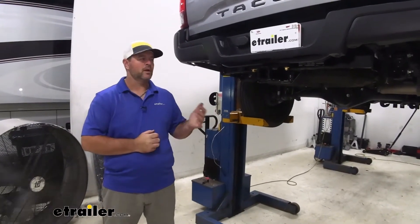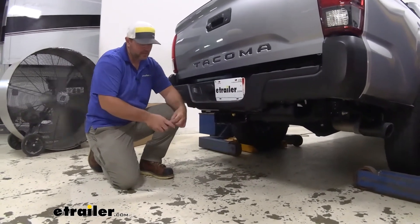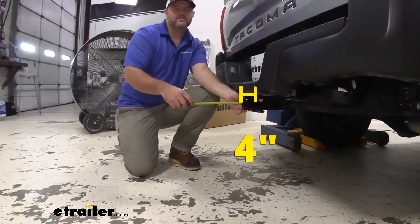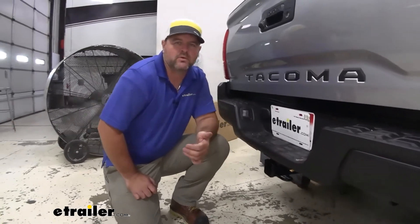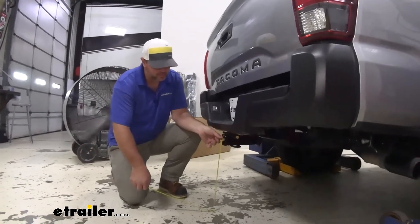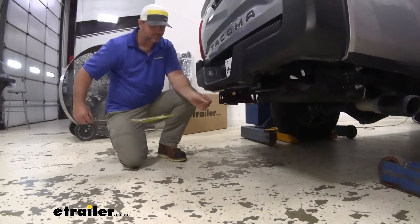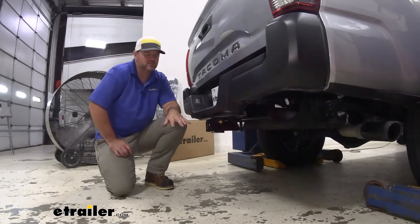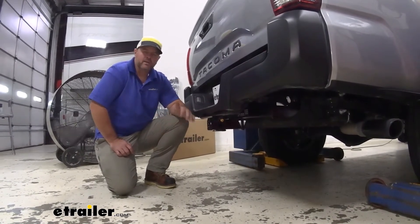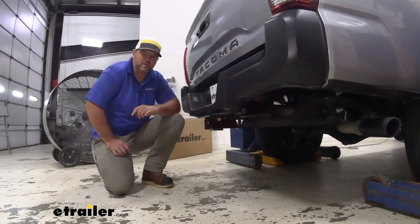Let's go ahead and get down on the ground, I'll give you some weight capacities and measurements. From the center of the hitch pin hole to the outermost part of the bumper, it's gonna be about four inches. This number is important for any of your hitch mount accessories like your cargo carriers and bike racks that fold up — we wanna make sure they're not gonna make contact. From the ground to the top innermost part of the receiver tube, it's about 18 and a quarter, 18 and a half inches actually. So you know we have plenty of height for different hitch mount accessories like your ball mounts. If you tow different size trailers, I recommend getting an adjustable ball mount so you can adjust it to the different coupler heights on those trailers — you can find different kinds here at eTrailer.